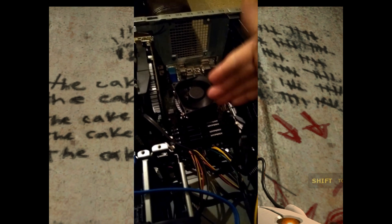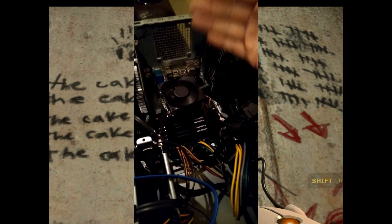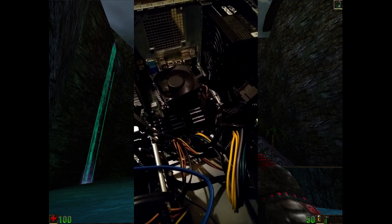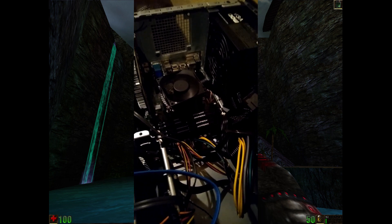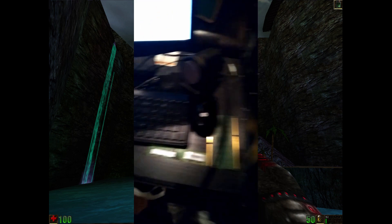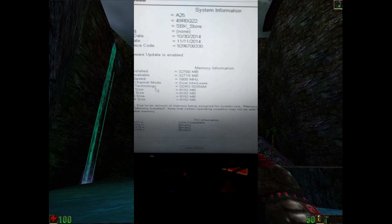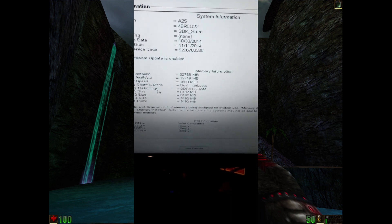I don't know — it looked like ash or cigarette ash, or maybe it was some old thermal paste — the heat goo. I don't know what it was, but there was something blocking. It was stuck on the back of my processor. I cleaned that off and it was stuck in the pins. I got as much of it out as I could with tweezers. And sure enough, I'm here at the BIOS and now I have 32 gigs of RAM.